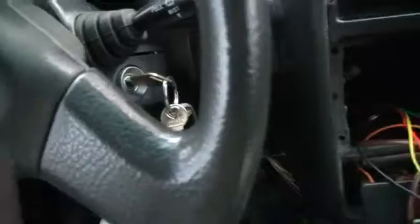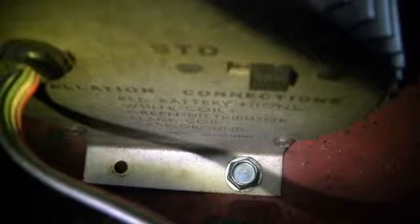Nothing. I guess next thing is to see if we got spark at all with like a timing light or something. Got an authentic old Sears inductive timing light. Turn it around - negative wire there. It works - let's try it out. There we go. No spark. Is black going to the points or green? Black - coil. And green is distributor. So green is a pulse in. I'm gonna try grounding this out with just a key on and see if it gives me spark.